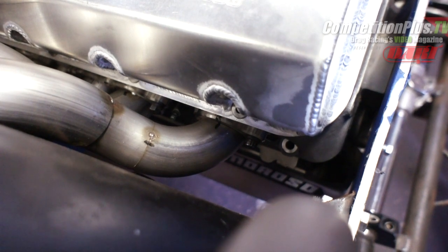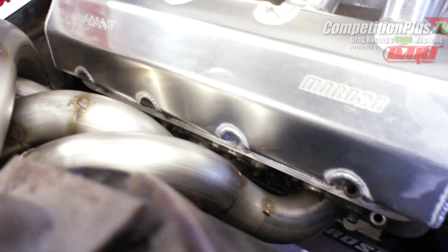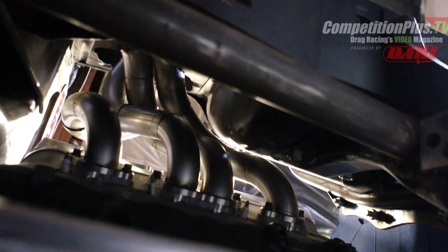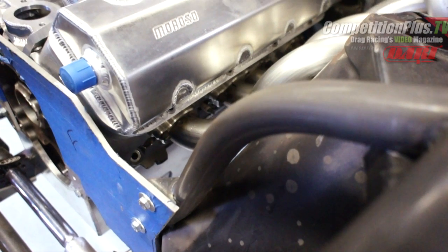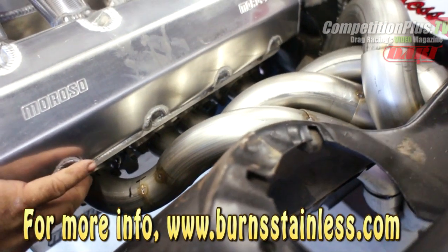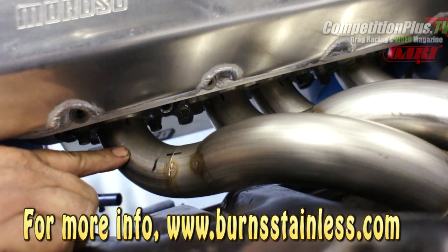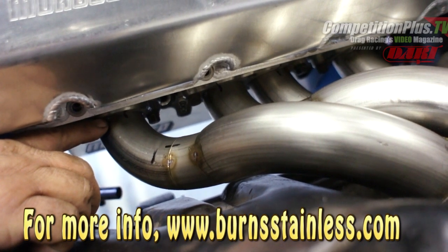It's really difficult to tack weld with the tubes on the car. When welding stainless, make sure the heat is low — you want a nice straw color. If you've ever seen a Burns Stainless collector and craftsman work, the precision on their welds will force you to be a better welder and fabricator just trying to follow what they do. One of the first things when starting a set of headers is putting the primary tube into the header flange — stainless flanges from Burns, CNC'd and very nice pieces. Always have the tube fully engaged all the way into the flange so it's up against the cylinder head, giving full support and preventing cracking. We also weld the inside of the header tube to the flange so there's no gap.